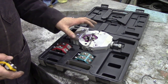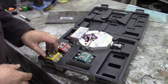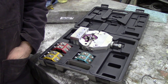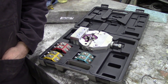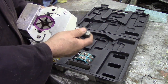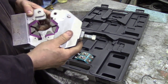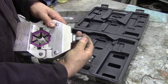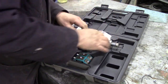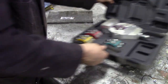This is my first generation of AC crimping tools — for putting crimps on AC hoses. When I do Land Rover conversions with AC, it cost me an arm and a leg to take hoses down to a shop to get custom ones made. After watching what they did, I decided to buy my own. This is a MasterCool kit — you put your hose in here with your crimp on, put a pin through, wind the bolt down, and it clamps the rubber around the pipe and makes a nice crimp. Great tool, but quite limiting in size range.